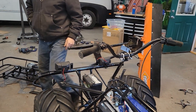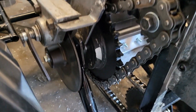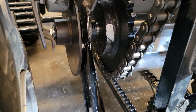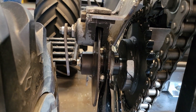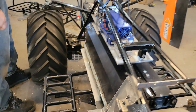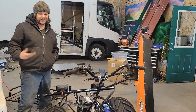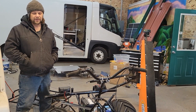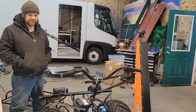You can check out the brake there — it's a pretty nice situation. It's right on the jack shaft, the intermediate shaft between the motor and the rear axle shaft. It's a disc brake with a real powerful power-screw type lever. That'll slow it down, and since every wheel is connected to the motor, it slows down every wheel — nice for even stopping.